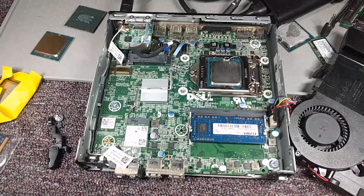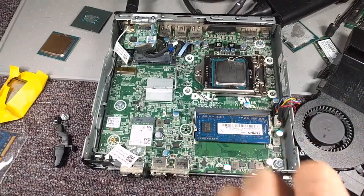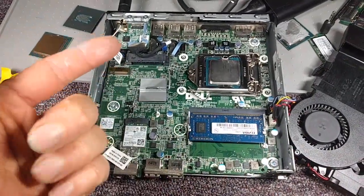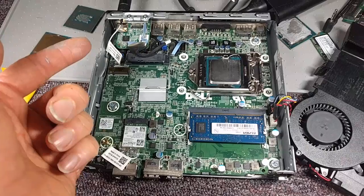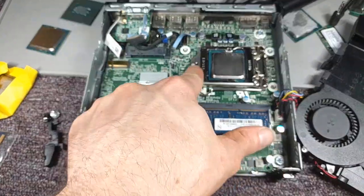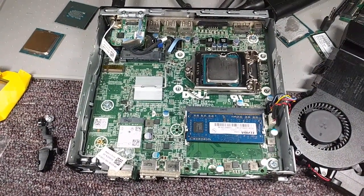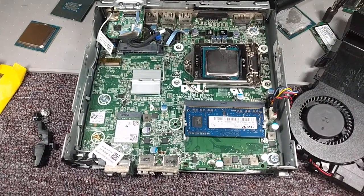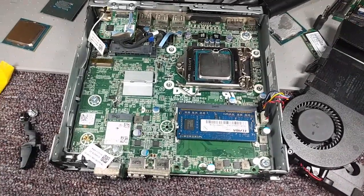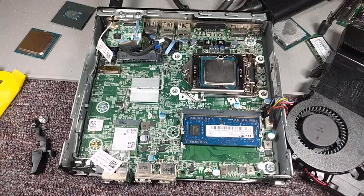I was not expecting that. I don't know if it's a reseating issue — it seems unlikely. I'm hoping it's not a pin connectivity issue from the flexing of the board. One of the design flaws here is that you have a lot of spring pressure loading into the caddy for the CPU. For most motherboards that spring pressure is a bit harsh, but for a tiny one like this you can just hear the board flexing when you put it down — it's kind of a cringe.